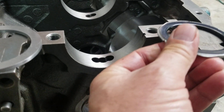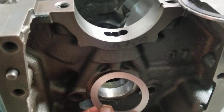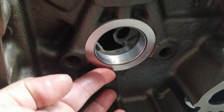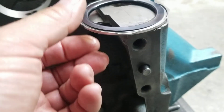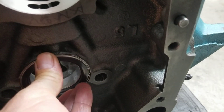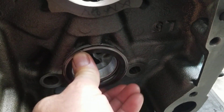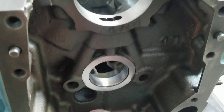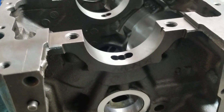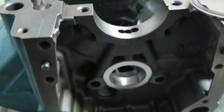What we've done is created a spacer, as we said we would. That spacer is going to go in here and we're going to fixture it — pretty much a perfect fit. The bearing will ride right on it, and now the inside will turn without any friction or locking up. We'll go ahead and modify the back of the flange of the camshaft to house this bearing so that the lobe in relation to the lifter bore is where it needs to be.